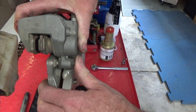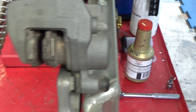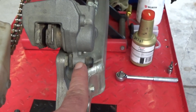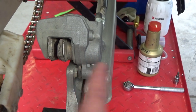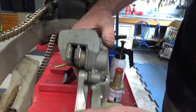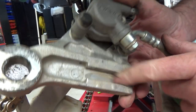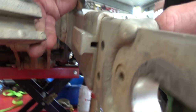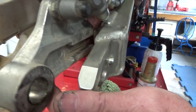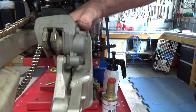You can see how this slides. Make sure that it slides — just want to make sure that it's greased and moves freely left and right. Now, the caliper's in a locator on the swing arm. Just pull it out and show them — we want to make sure that this is cleaned and also has a bit of lube. You can see where it's got a wear mark in it. There's a lug welded on the side of the swing arm that it slides into. I'm going to put that back in because to loosen the bolts, we want it to be a little bit firm. We'll just put that in there for now.